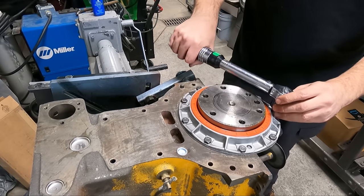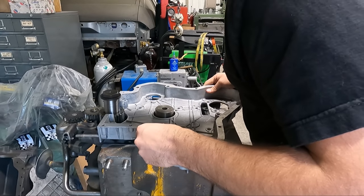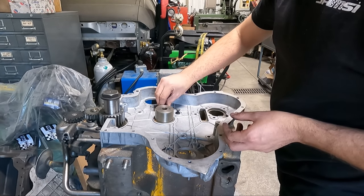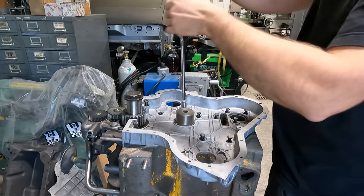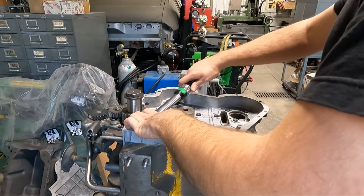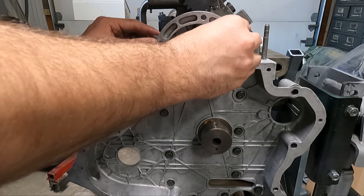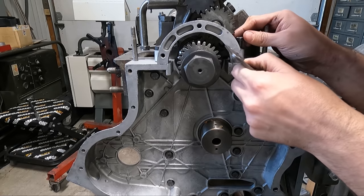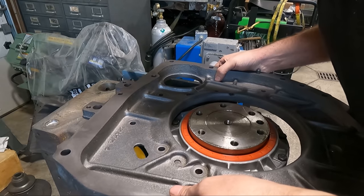Next I jumped over to the front side of the engine and started working on getting the gasket installed for the timing gear housing. The aluminum housing kind of locates on that idler gear shaft and it has about a million different bolts that have to be installed to hold it in place. It's important to note that these bolts are special short-headed bolts so that the gears installed later do not rub against the bolt heads. The face of the front piece needs to be coated with a light layer of silicone and aligned to the front edge of the timing gear case using a straight edge so the cover will seal correctly later on.